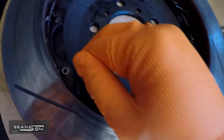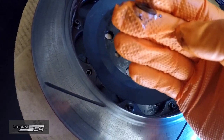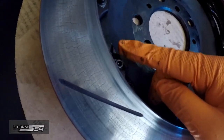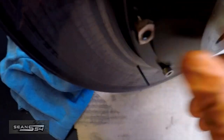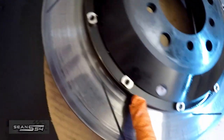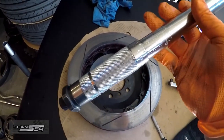Stop Tech said all I have to do is get this dome washer and flip it this way so it doesn't put force on the rotor, so now the system will float a little bit. This is essentially a free mod. I'm flipping the washer, putting it back, and reinstalling the bolt. All the washers have been flipped. Make sure this hardware is oriented the right way before you tighten it all down — some of these are turned. The torque specs for my Stop Tech rotors are only six foot-pounds, so that's not much at all.